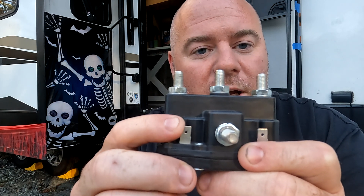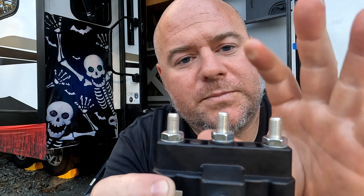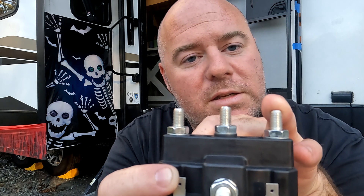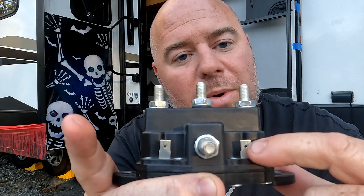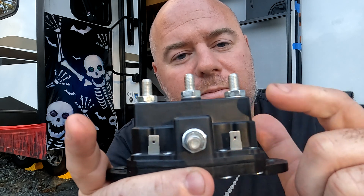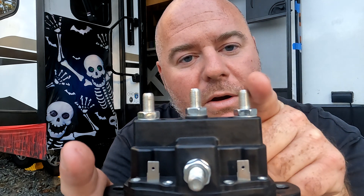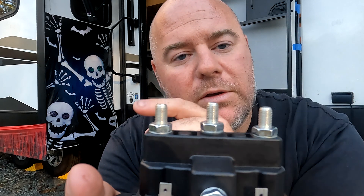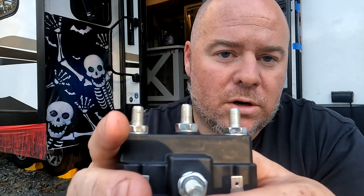What it's going to do is send 12 volts to one signal stud. It's going to take the battery power from the two center studs — one is ground, one is positive — and send 12 volts to one motor stud and negative battery power to the other motor stud, which turns your motor in one direction. To switch voltage in the other direction, it sends a 12-volt signal to the other stud on your reversing solenoid, which puts positive power on the opposite motor stud and negative power on the other — reversing how your electric motor works.